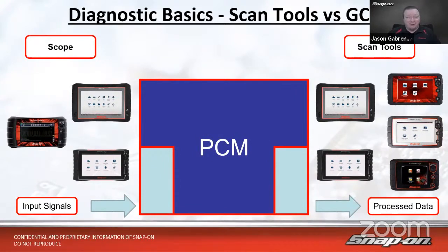The data you see is the computer's interpretation of what it's seeing based on its programming. And if you've been around long enough, you know the programming isn't always all that great — that's why we have reflashes where we have to reset the computer and change the software. So to test signals before they get to the computer — where you won't have that data stream — you need a scope to actually check the sensors themselves and other things underneath the hood.